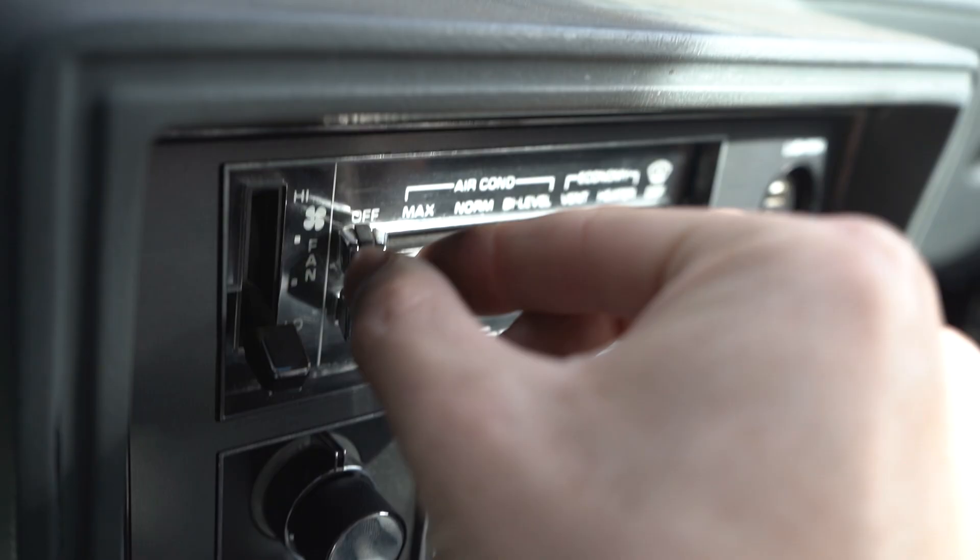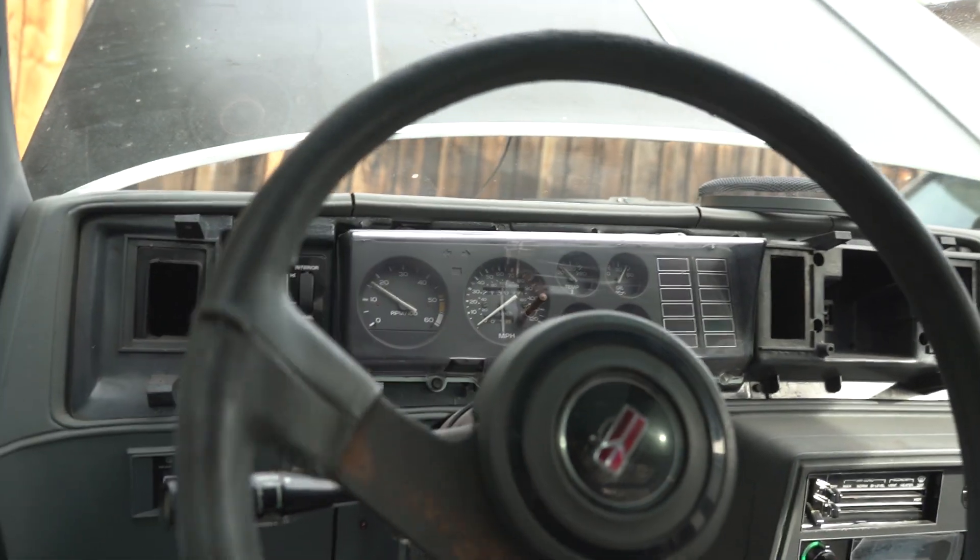The power steering pump is wired and plumbed. It's temporarily wired into the blower motor so whenever I flip the AC switch the pump turns on. Final test is making sure the car still starts and that the power steering works. I think I added probably 5–10 horsepower just by removing the old-school pump, since those do suck a lot of horsepower. The car starts — let's flip the AC on. Yep, we got power steering. Turn it off. Yep, lost it.